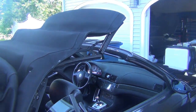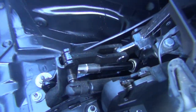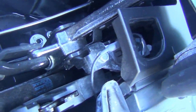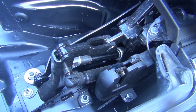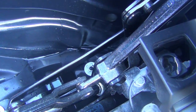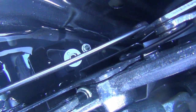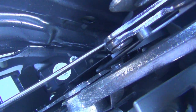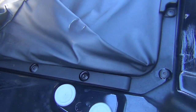You need to open the top to this position so the rear panel is up, and check in here at this mechanism linkage. There's a drain underneath this base plate, so what you need to do is spray some water and verify that the drain is draining. Looking here, you can see standing water — so this side is not draining on the right side. What happens is the water runs back through all these cavities, and this cover right here for the partition allows water to get right through and into the trunk.